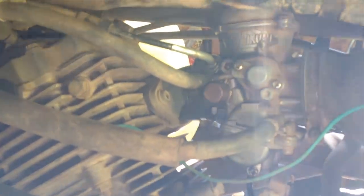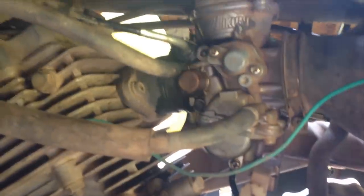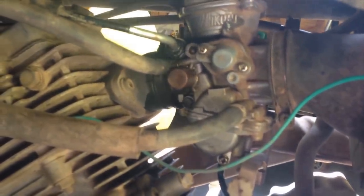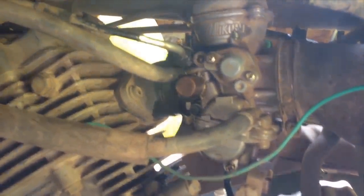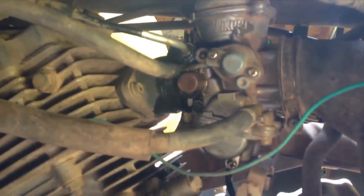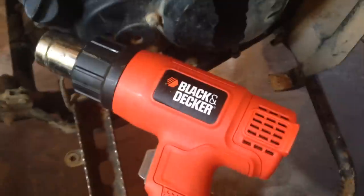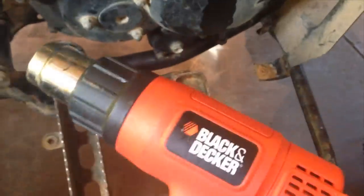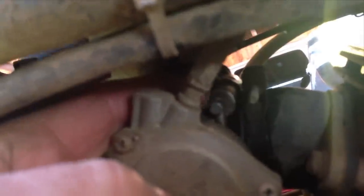So I think I'm going to apply some heat to it. I really don't want to pull the carb off this thing — I'd really rather not mess with it. It runs great when it is running, and hopefully a little bit of heat and some elbow grease and I can pop this sucker right out. I really don't want to put a torch under there because I don't want to melt possibly any of the rubber fixtures, but you can see the back of the carb here.